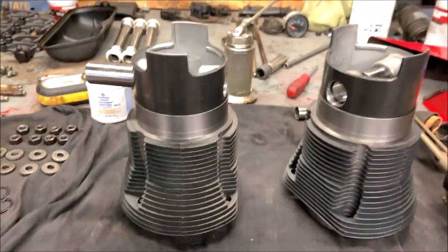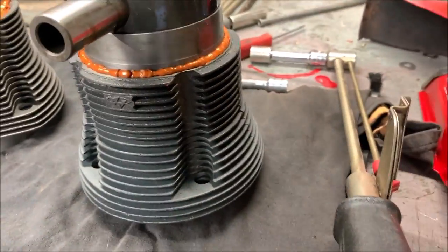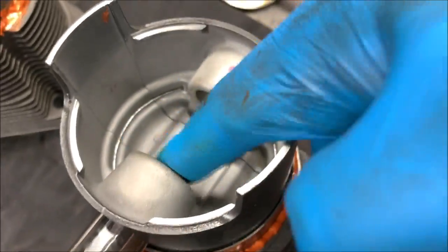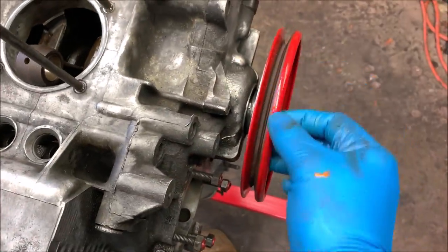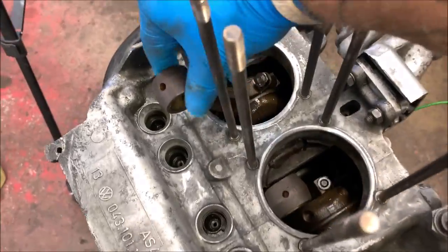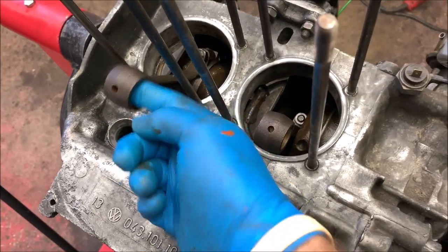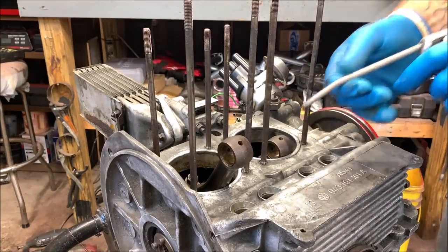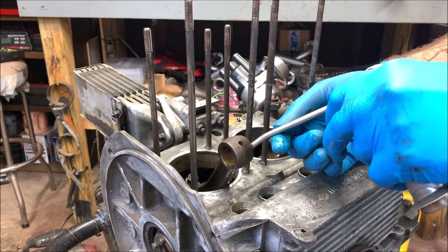I use ultra copper around the cylinders — it's what my buddy always used and never had an issue. Use what you want; everybody does something different. I got my ultra copper around the cylinders. Don't go crazy with it, just enough to seat them. I oiled up my wrist pins and slid them through to the point where once the connecting rod goes in you can push it right through. I've got my pulley on there to turn it so number three is all the way out. Put a little oil through this hole and smear it around so it slides through easier.